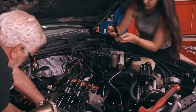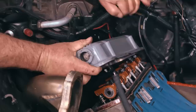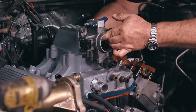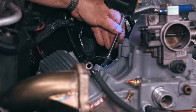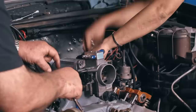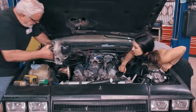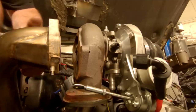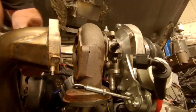These are factory gaskets and they're already notched, so you can put two bolts in to hold the header in place and then just drop those down. Moving on to the intake right now — I made a front valley gasket and rear valley gasket out of silicone. The deal is to get it lined up and set down in one easy motion. Turbo's going in. Pretty good fit right there. We're getting pretty close to wrapping this up — Lucky is finishing up the turbo and then he's going to pop over and put accessories on. We should be pretty close to making some noise.